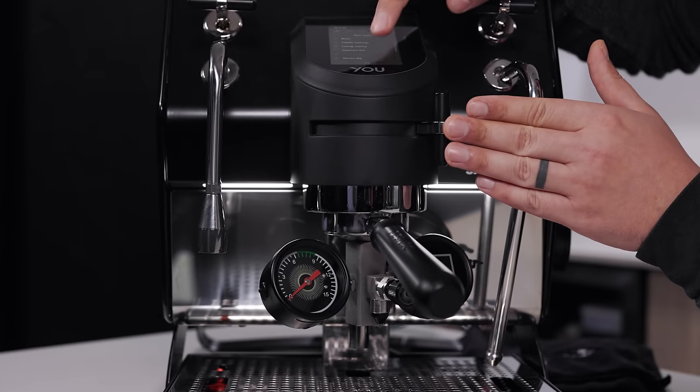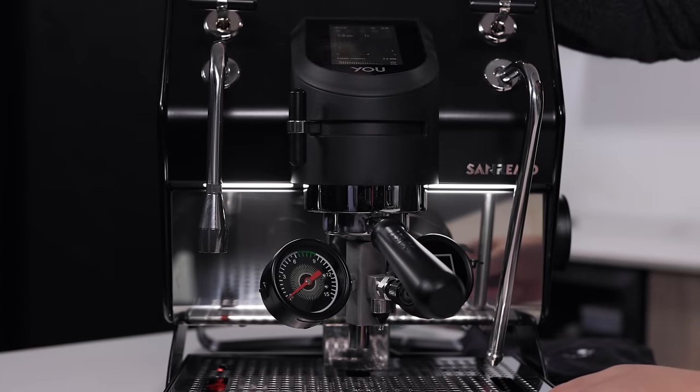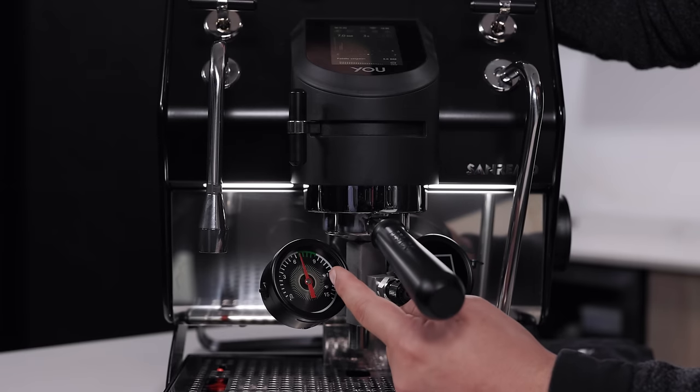Barely open the valve, so it's kind of replicable of a puck that's really tightly packed and the water has to saturate everything. But I want you to watch what happens to the pressure right at the beginning. So I need to set this. Now we're set where the top pressure here is gonna be 6 bar. I yeet it to 6, it's filling that puck, and look, it overshoots quite a bit.